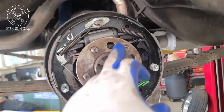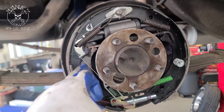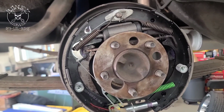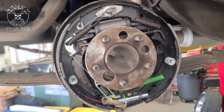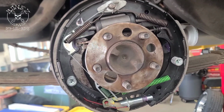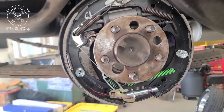So you can see there, that's our self-adjuster setup right here. All of this, including the guide, they are all self-adjusting parts that belong, or I believe belong, on a car. I don't think that they should be left as a non-self-adjusting brake shoe. It's just so much safer this way. Keeps the pedal nice and high, keeps everything where it's supposed to be. So we made them self-adjusting.